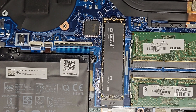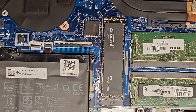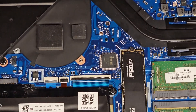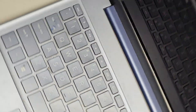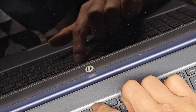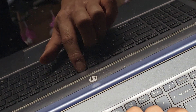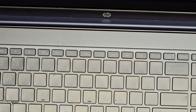To test it, we're going to start it up before we put on the bottom cover. I believe this had Windows 10, so we're going to install Windows 10. I have a Windows 10 USB installer created with Microsoft's utility, so we're just going to get that USB in there. We're going to carefully open this up and power on the computer to get to the boot devices — you press F9 on boot. Usually I'll press the power button and then keep tapping F9 repeatedly. I think the battery is dead, let me go get the charger.